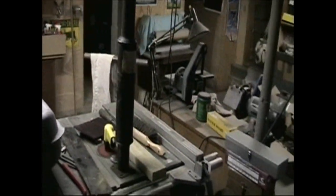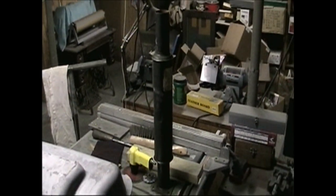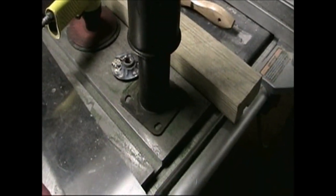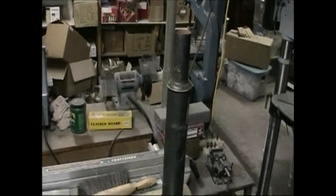And then here is a new exhaust muffler. Oops. That's a new old stock John Deere muffler. You can see the bolt-on flange here at the base. So we'll unbolt the stub that's on the tractor now and bolt this in its place. And then we got a new exhaust pipe to go along with it. And I just won on eBay a new manifold to bolt up to it here with the casting's no longer broken, so we're going to have a complete new exhaust system starting at the manifold all the way up to the muffler, and that'll clean that mess up.